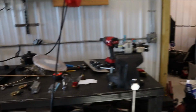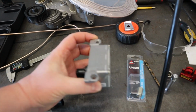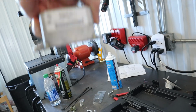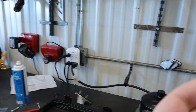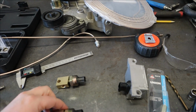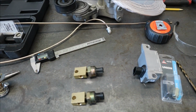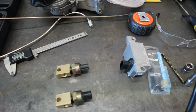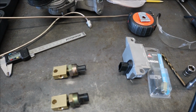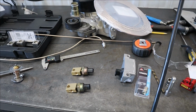And then a few other parts. You get a yaw sensor, and what I'm told is this attaches tabs up, so you'd think it would go in the car like that. It goes in like this, and the plug goes towards the front of the car. And then two pressure sensors, one for the front, one for the rear. This goes between the master cylinder and the ABS pump. And then you need a harness to connect all these sensors, all your wheel sensors, your ABS pump, and these guys. And I got a gentleman named Doug that's doing all that.